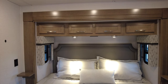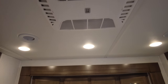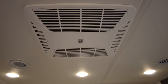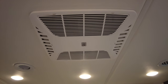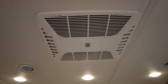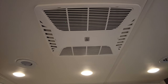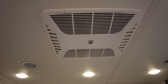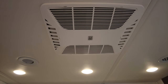You've got a king size bed in here, a control panel up above the bed, and more cabinets for storage. The 15,000 BTU heat pump — all the AC is ducted throughout the coach. On soft starts for air conditioners: if you're a super light sleeper there could be a lot of value in adding a soft start. What it does is take that big thump out when the AC kicks on, making it a much calmer, slower startup. There's some controversy about whether soft starts do any long-term damage or shorten the lifespan of your air conditioner, but there's nothing out there that proves it does. If you're a light sleeper, it's probably well worth it on the rear unit at least.